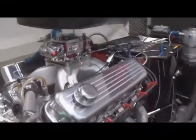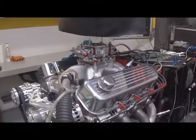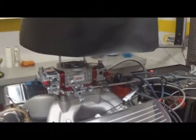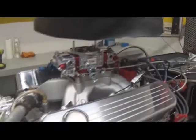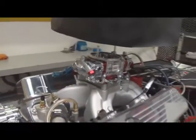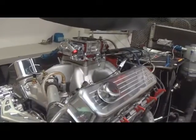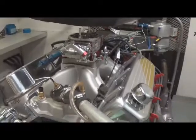This week we're going to give you a little insight on a test of Holley's Terminator on a basically pretty close to 700 horsepower big block Chevrolet. We ran this with an RQ 1050 Quick Fuel carburetor. It's got a little hydraulic roller camshaft in it, so it's only got about five inches of vacuum. We've baselined it, and now we're going to switch it over to the Terminator and just see how it runs.